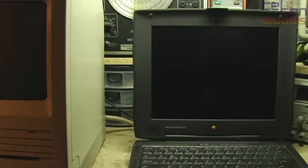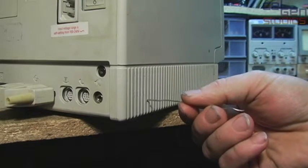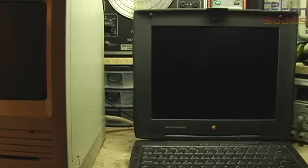Once you have all your wiring set up, go ahead and turn on your compact Mac. The moment you get to the cursor, hit the interrupt button. You're going to get a sad Mac displaying on the screen, but that's totally okay. Basically what we're trying to do is halt the system and prevent it from doing anything with the SCSI bus while we're working on it. This just prevents it from suddenly finding a valid system folder and trying to boot it and causing all sorts of problems. Now it's in a state where we can directly access it from another machine.